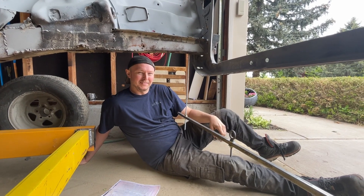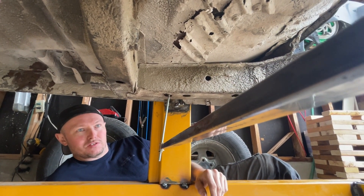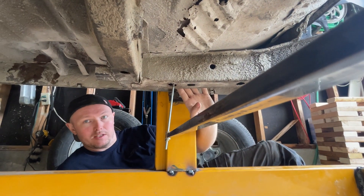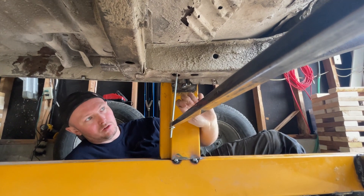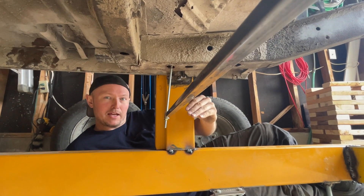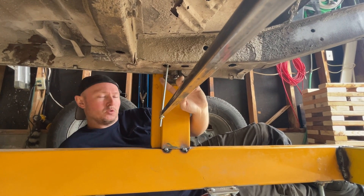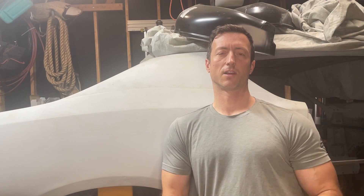We were talking about gauge holes being in bad shape and not good enough for accurate measurement. We're not too concerned about how these gauge holes look because the front and rear rails are coming out of this car. But this front one here — you can see it looks like it's had a speed bump issue and it's actually bent the gauge hole up. If you were to set this to the proper height, it would show the rail going up on an angle and throw off all the gauges. We know it's off already and we're taking these rails out, so it doesn't matter much. But when we go to put in the new rails, all the gauge holes have to be perfect to give us an accurate measurement of the frame and make sure everything's true and at the right height.